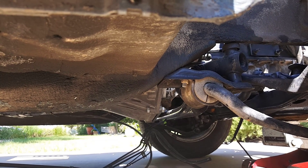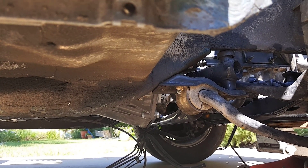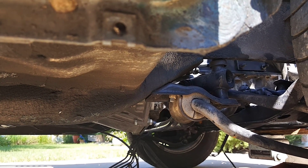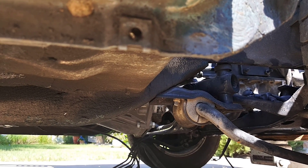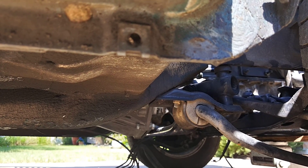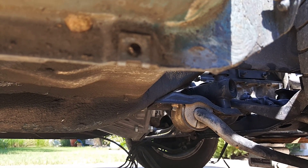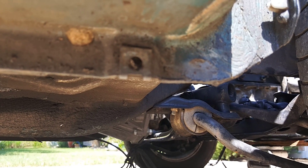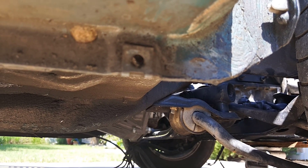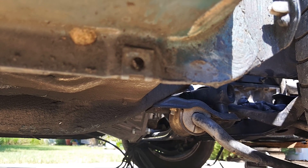Now let me show you the other issue with the Mercedes diesel 4x4 adapter. Coming down under the car, you can see that transmission adapter bolt that goes through the housing actually wants to hit the sway bar. I think that's pretty easily remedied — when I take this engine out to paint the engine bay I'm going to have the bolt head face the sway bar, not the nut and threaded part. That's an easy fix to get some clearance there, but it's still pretty close. Now I need to go ahead and make the mounts that will sit on top of the perches.